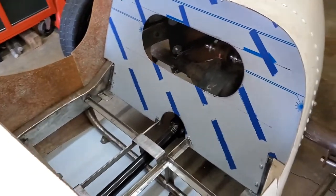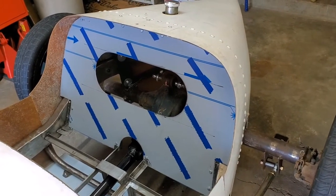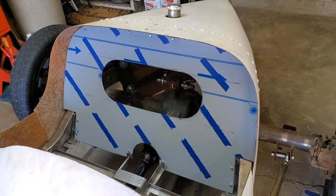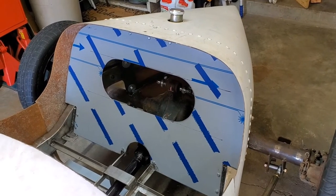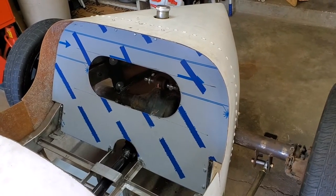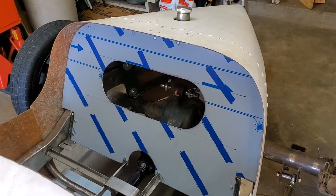With the majority of the chassis work done, I've been able to start installing the interior panels, beginning with the rear bulkhead and belly pan. I thought about making it from aluminium, but that stuff is really pricey to import from England, so I decided to use the more domestic aluminum, which I could source locally. The bulkhead, made from 063 sheet, isn't just decorative — it's actually a structural panel. It's like those department store bookcases that are all flimsy until you nail that paper board backing on, then they're as solid as a rock. The rear boat tail was pretty flimsy and would bend under any pressure, but one aluminum panel later it's as solid as a tank — when you push or pull, the whole rear end of the car moves. It's really impressive how much of a difference it made.